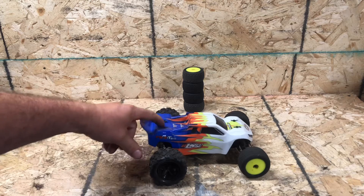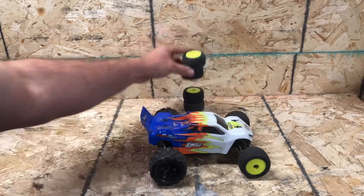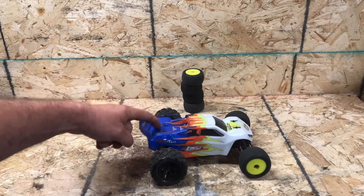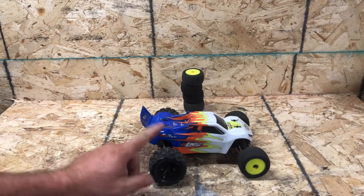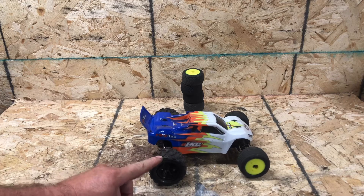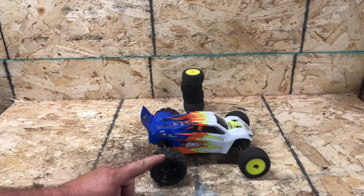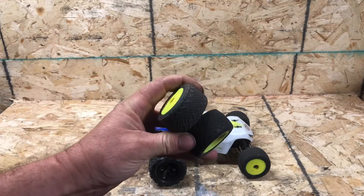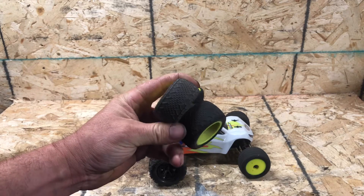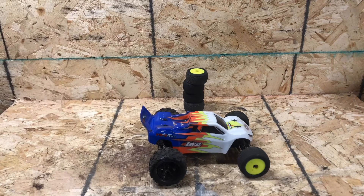So what I did was find these on eBay — 12 millimeter to 8 millimeter adapters — and that pretty much cured everything. This is a lot more fun on the dirt than it ever was with the stock tires. Way better. That's pretty much the easiest way to get some aftermarket wheels on this thing, because tires that give you grip on dirt are pretty hard to find. If you're running on asphalt, carpet, or smooth surfaces these stock tires would be awesome, but on any kind of loose dirt they pretty much just want to wheelie.